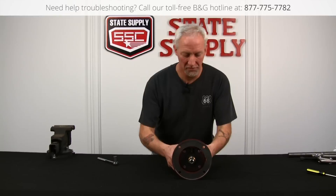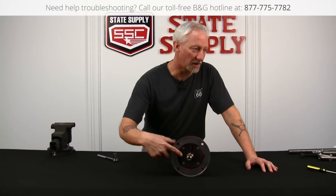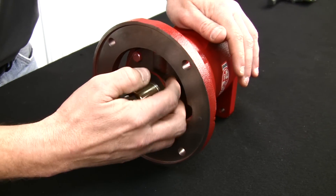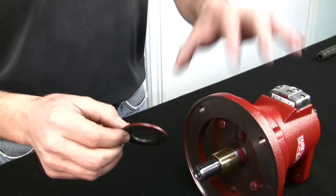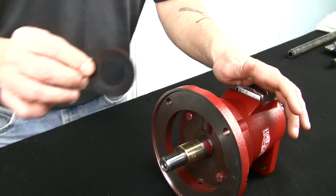If you notice, there are four screws — four bolts — on a cover type plate for the bearing, shaft, and housing assembly. We'll start by taking these off. This water slinger is still on here, and we'll take that off first. Make sure it's pliable, good and soft, and tight on the shaft. This one is brand new, so we'll reuse this.